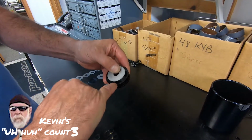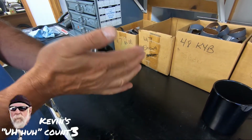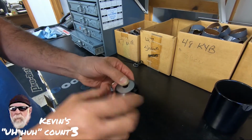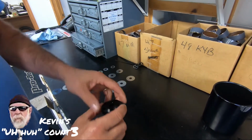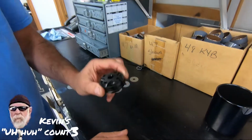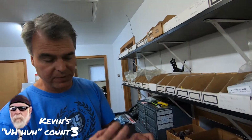As the oil comes down, it goes through this hole, comes out these holes. That's where your compression stack is. Opposite end of the stroke goes through here, out these holes. That controls your rebound. These are your compression holes. We use a little smaller hole in our compression than what the stock pistons have. The stock theory is you flow as much oil as you possibly can, and control it with a stiffer valving.